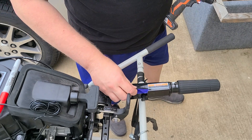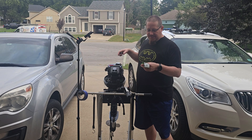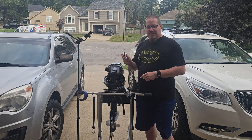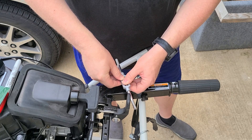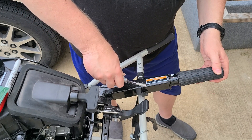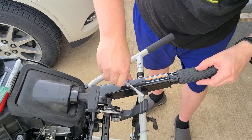The next step is to actually cut the screw holes into it. The screws I chose were number six screws — I brought my hour meter in to make sure I got heads that were big enough and not too fat to go through. Number six by 32 calls for the number 7/64ths drill bit, which is what I used. Now we take the tap and slowly turn as we cut. I'm also tilting my arm up so I've got enough clearance for it to spin. We've got that drilled through and clear, and now on to the next one — we've got it all the way through.